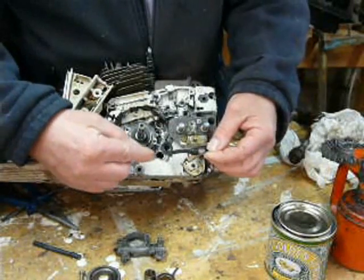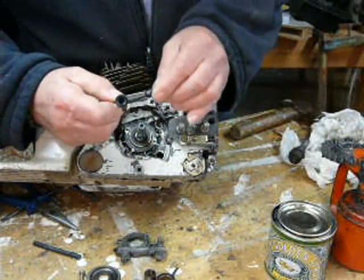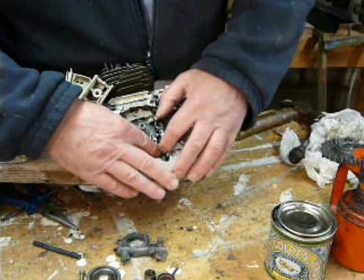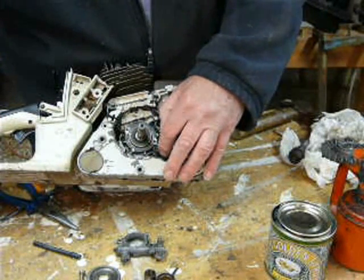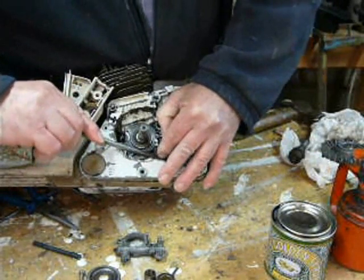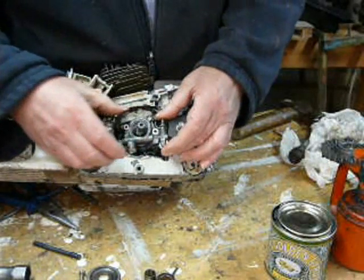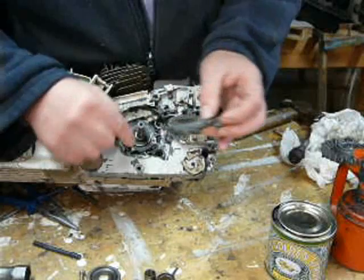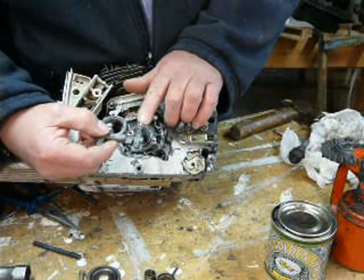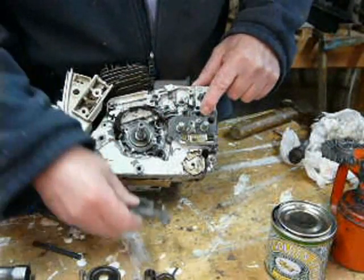It goes in there like that, so this little tag here sits down in that hole. If these rubbers get really hard and brittle, just change them — it's just not worth the grief for continuing with them. I'm using a broad screwdriver here so we don't stab into there. As you see, that pops in there reasonably easily. The oil pump goes like that — so that's the adjustment which is accessed from underneath. That's the input which fits in that rubber, that's the output, and that goes into a pipe that ends up here. So that's the oil pump.